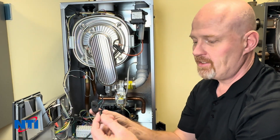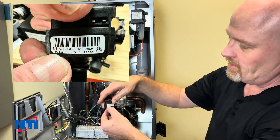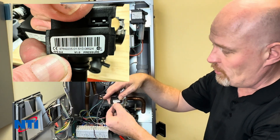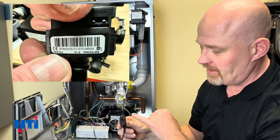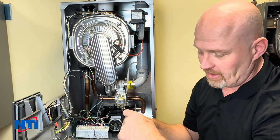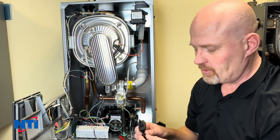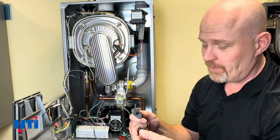Now that we've removed this, you're going to get a new one. Make sure that it says RPS on there for pressure — if you don't see that, it may not fit. There is a flow sensor which looks virtually identical; it typically comes with a green o-ring gasket. It will not fit in place of the pressure sensor, or if it does fit, it won't work.